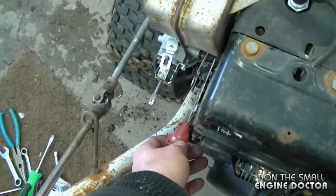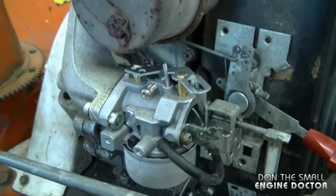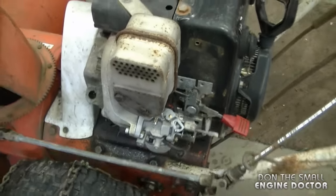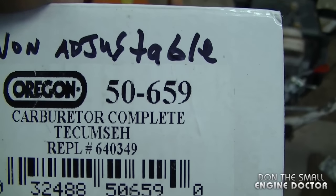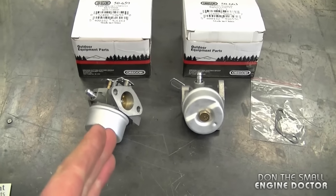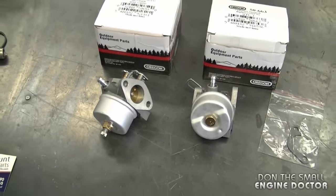In this next clip you're going to see an older snowblower that I've actually installed one of these carburetors on. On this older Ariens snowblower I put on the Oregon non-adjustable carb, part number 50-659, which replaces Tecumseh carburetor 640349. As you can see, the carb runs really well. I'm really happy with the quality of these carburetors — they do a good job. A lot of people prefer having an aftermarket carburetor for half the price rather than paying full price for an OEM one.